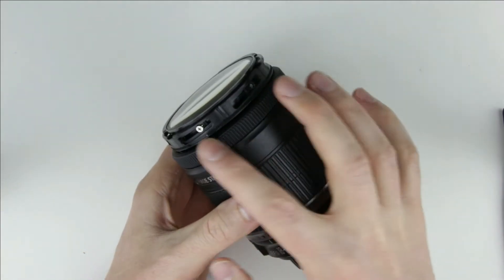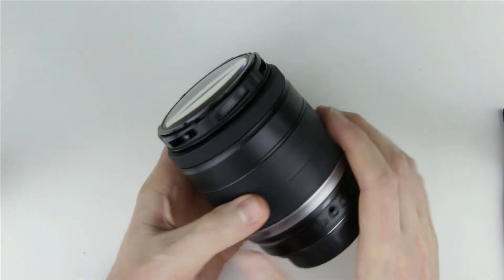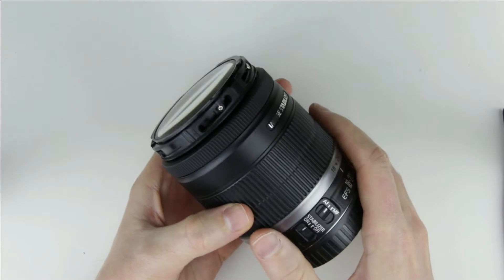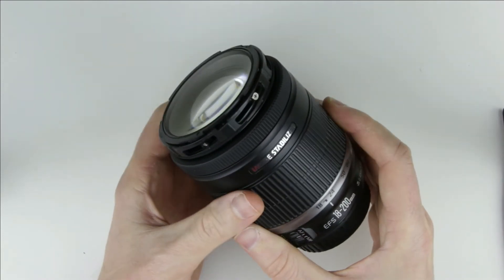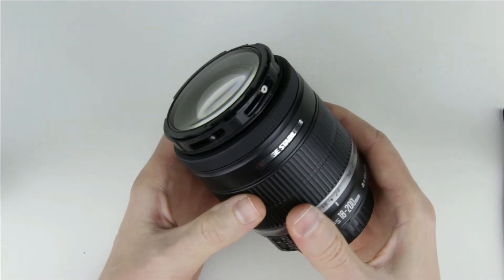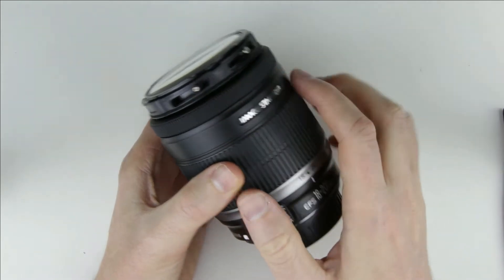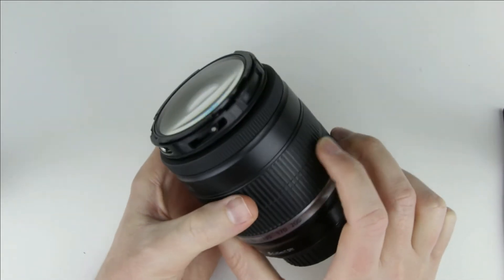On the side of the lens there are 4 screws. Two of them are eccentric screws, which are used to calibrate the lens. It is very important to put back the screws to the place where they come from, and in the case of the eccentric screws, the position of the plastic ring should be the same. Let me show how I do this.